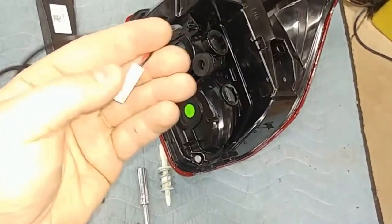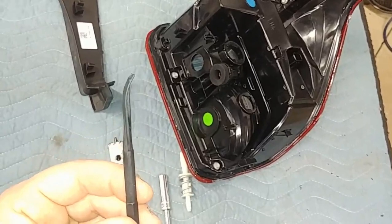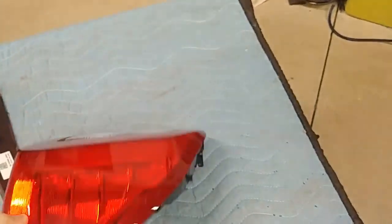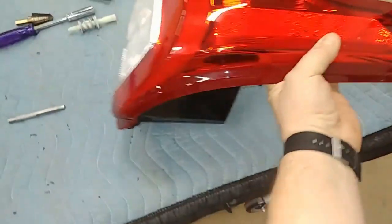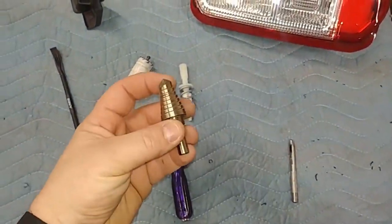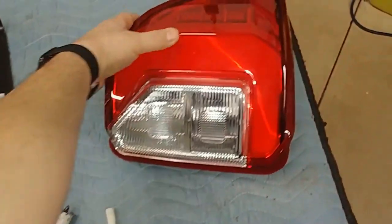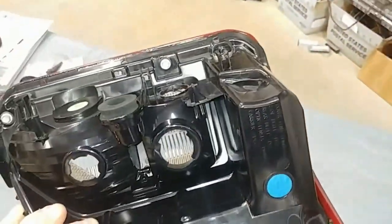This is how we mount the light — we mount that in there. This is my favorite tool for removing those little panels: a very thin pry bar. The thicker pry bars seem to leave gouges in the plastic, so we found these thin ones on Amazon. Got a one-inch hole saw for drilling a hole — always a two-person operation. Hold it on the edge, hold it down, drill from the bottom up, and make sure your shop vac is close by to suck all those shavings out before they scatter around the lens. The other option is a one-inch unibit — this leaves a nice clean hole. Either one is more than acceptable. Here's your 11-millimeter socket and there's your 3/16ths punch tool. The end result is going to be a nice clean hole — that's what we seal our hideaway into.